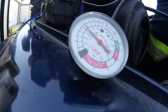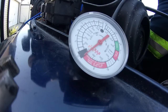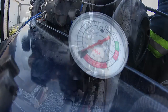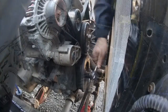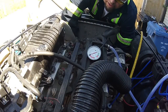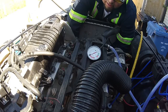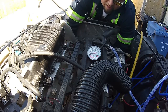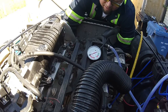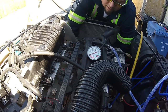Compression... and it just dropped. As I was mentioning, this will get you close to top dead center — you go into compression, it hits, and now I'm reading vacuum. Then you go back. You've got to try to find that magic spot in the middle. It should be right about there.